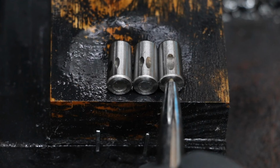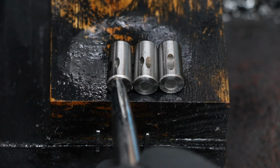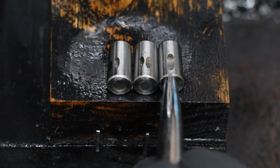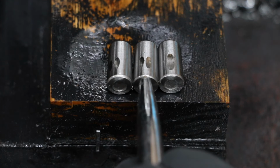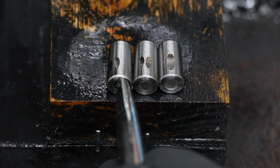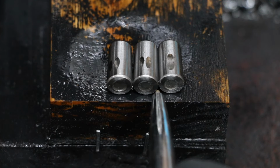The bearing all the way to the right is Zmax, 100%. This is the Zmax oil mix, and this is just oil, 10W30 conventional. It looks to me like the Zmax is doing very little for film strength. In fact, there's a tremendous amount of damage, the most damage I've seen in any of the testing to date. The Zmax oil mix just doesn't seem to be doing any good for the oil, doesn't seem to enhance it in any way. So it'll be interesting to see how Lucas Synthetic does compared to Zmax.